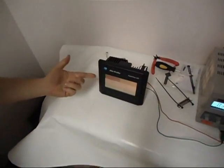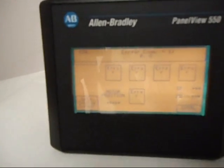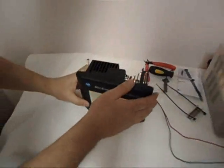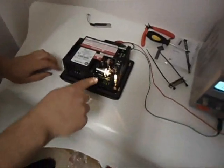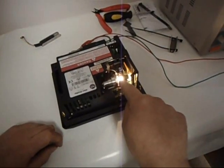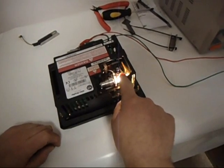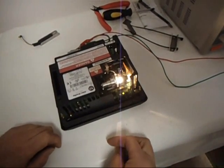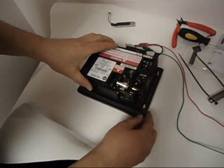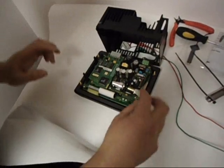We have an image on the screen now — you can read it, it's fine. The other thing that happens is, because this produces so much heat over time, there's a little lens in here — the plastic gets brittle, and when the lens falls off, all the heat from the light goes into the fiber optic, and the fiber optic melts. So this process right here is going to remove a lot of the failures just by removing this light for the 550.